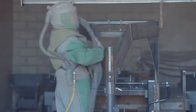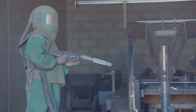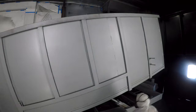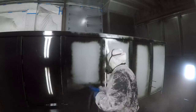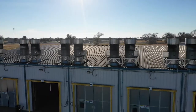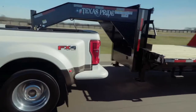The paint and finish on the trailer are nothing less than top notch. The process starts with a full media blasting to remove any surface rust or scale. Then each trailer is fully primed top to bottom in preparation for the two top coats of automotive grade acrylic enamel paint, all of which is done in our new state of the art paint facility. This ensures you have a protective, durable and shiny finish for years to come.